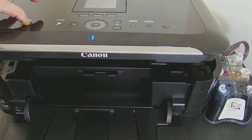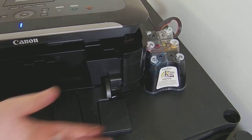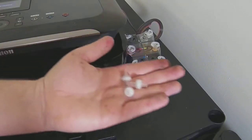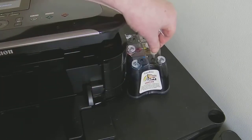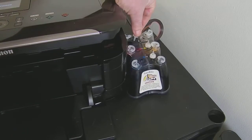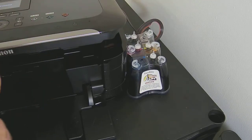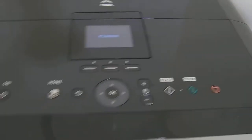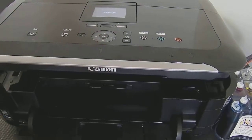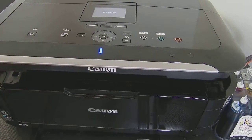The printer is powering on and running through a few checks. We also need to install the air filters. Within your accessory pack there are air filters with a narrow pointed end and a short stubby fat end — they get inserted with the narrow pointed end facing upwards, one into each air breather hole. They will allow the system to breathe. The printer is now running through its cleaning and purging cycle. Load some paper into it and let it do its head clean and whatever else it needs to do.